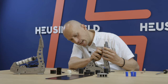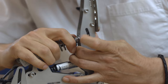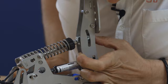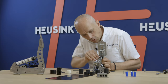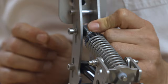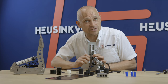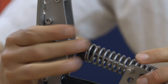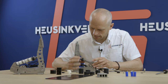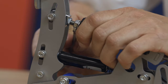Now the whole assembly goes back in — just slide in the rod end and push it into place. Now here comes the hard part: you're going to have to use your thumb to align the axle with the slot so you can screw the bolts back in. If they don't go in smoothly you're not aligned perfectly, and you have to be — otherwise you might damage the thread on the bolts. So be precise here. Both bolts go back in, then add preload as you desire. Always remember to tighten the lock nut as well so the preload will not shift in future.